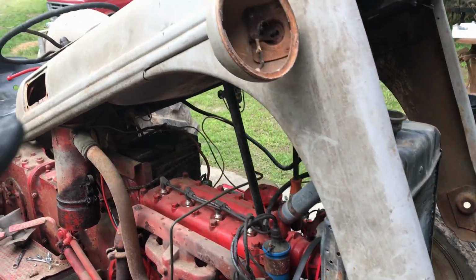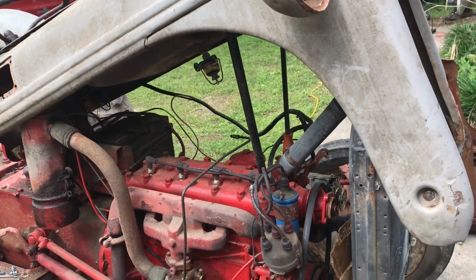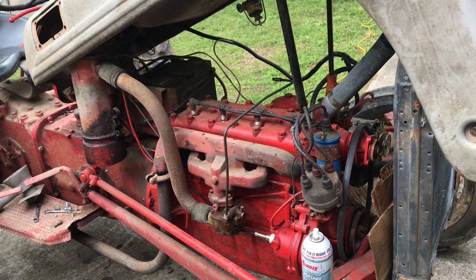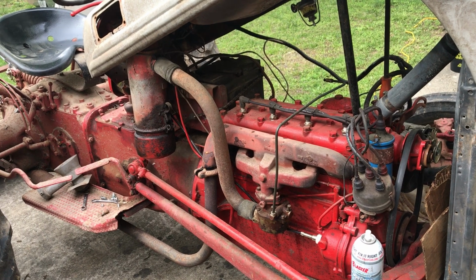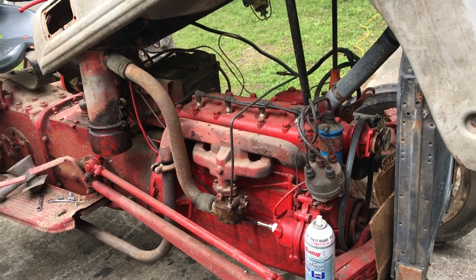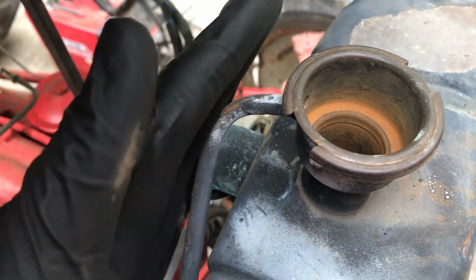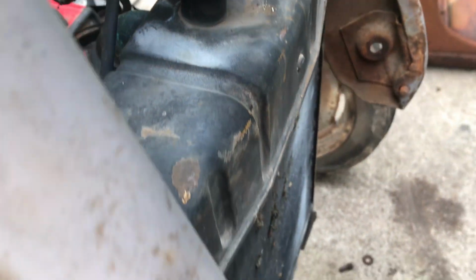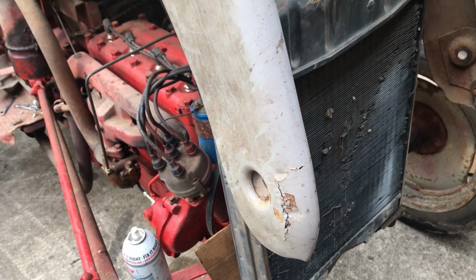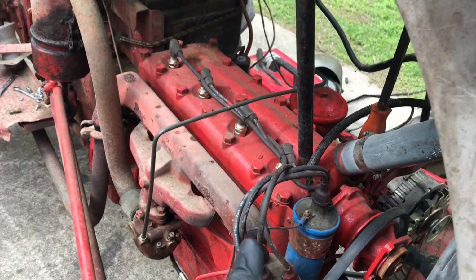Trying to get it, you almost need a person on each side of it, you know, to lift it in. I put it on by myself. I drained the fuel out of it and was able to put it on there. I could drain the fuel back out of it, but no reason to take it off when we just need it up. And I loosened the top radiator hose and was able to just push the radiator a little bit. It just mounts at the bottom, on some rubber pads, so I was able to push it over a little bit and get the fan out.